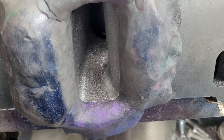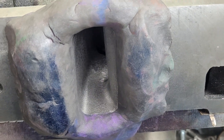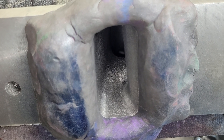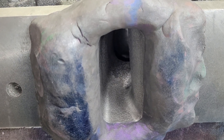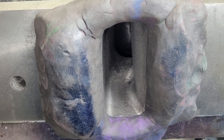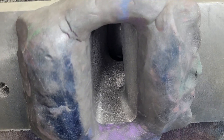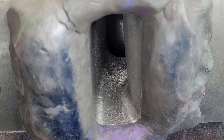You can see how it lost it over the short side a little after 500 thousandths. It's much more stable at 500 thousandths than it was before. We had around 274 CFM at 500 thousandths, which is not a bad number.